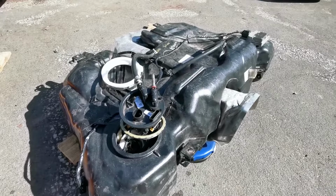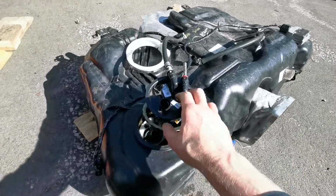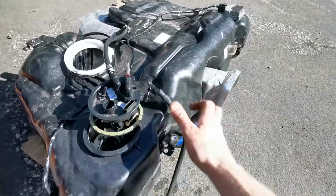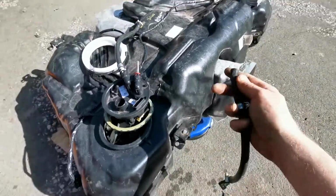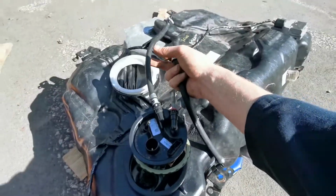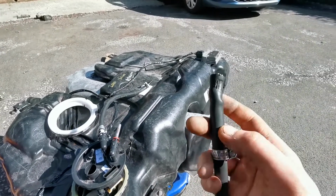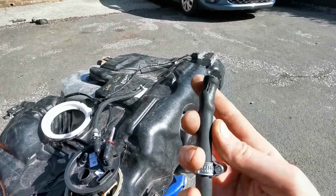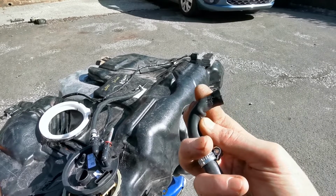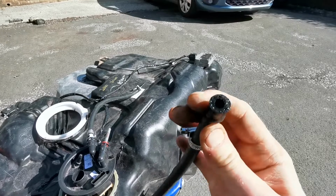Right guys, so back to this tank here, and I think I've just spotted the problem. So pulled off the tank top, and that pipe that I used, which wasn't the right stuff, obviously, as I said, it wasn't submersible pipe, so it's the same as the outlet pipe here. What had happened is, as you can see there, it's got a little bulge in it, so this thing had somehow sort of gone like that. It's gone all soft. So just goes to prove, you've got to use the right stuff.